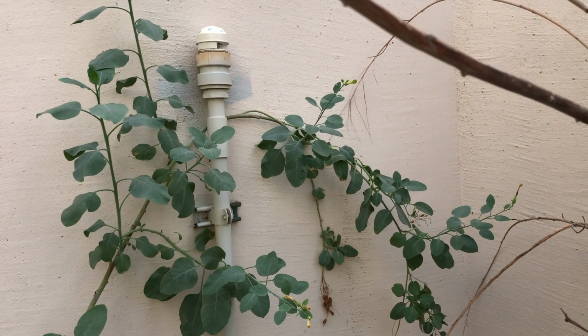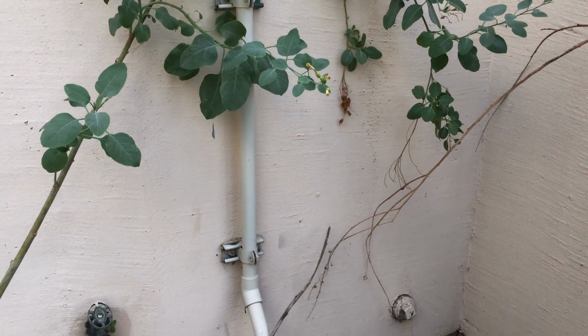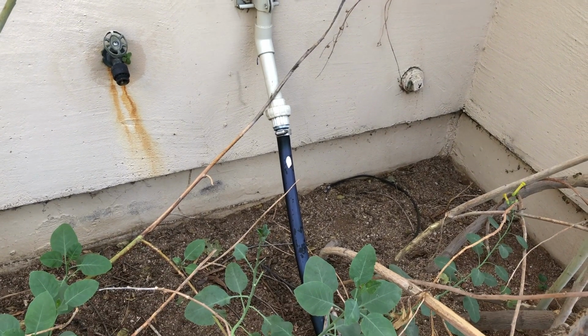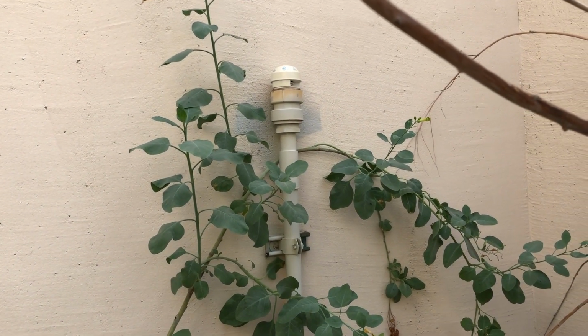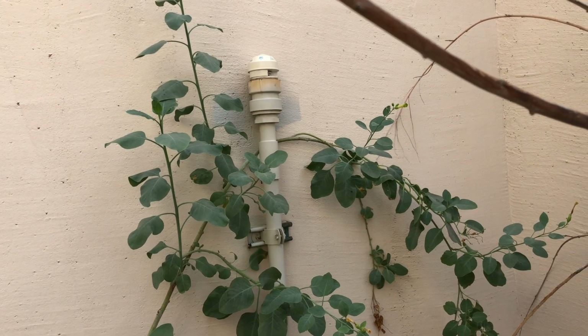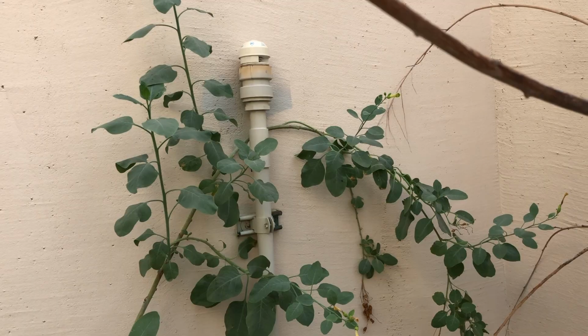And that's important because as the washer goes into draining the tank between the wash cycle and the rinse cycle, you want to make sure that all the water gets out, but then when it starts to fill the tub again, you need to have this line break its vacuum. If not, it will just siphon all the water out of the tank.